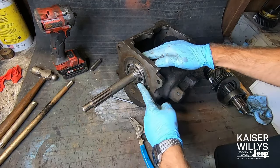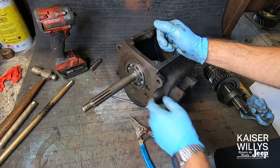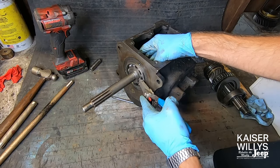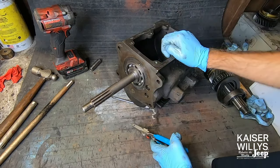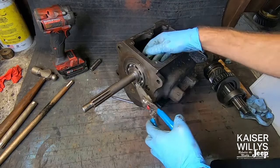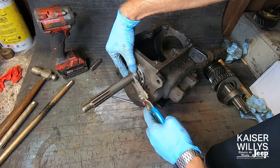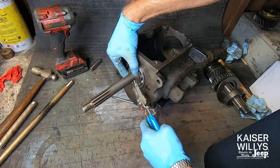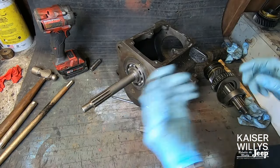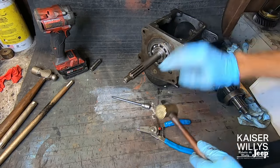There are several different ways to do the next step. I'm just showing you the way I've done it and it's worked well for me and doesn't require a press. This front bearing is pressed onto the input shaft and retained with a snap ring right here. We don't need to remove the snap ring on the bearing — we're going to take the one off of the input shaft and use that and the transmission case to help us remove the bearing from the shaft. This snap ring can be tough. These are not the correct snap ring pliers for that — you'd want the flat build one — but sometimes you just have to get by with what you have. Just take your time. A screwdriver can help sometimes, but if you're patient you'll get it. Once the snap ring is off, set that to the side, then take a brass hammer and just tap on the input shaft and it will press that bearing off of the shaft.